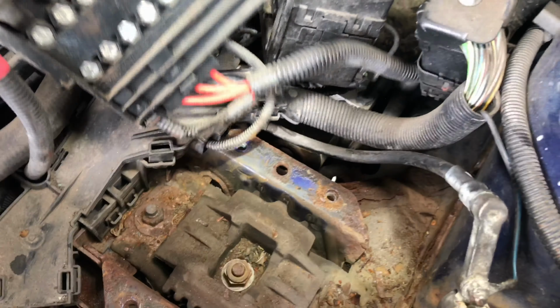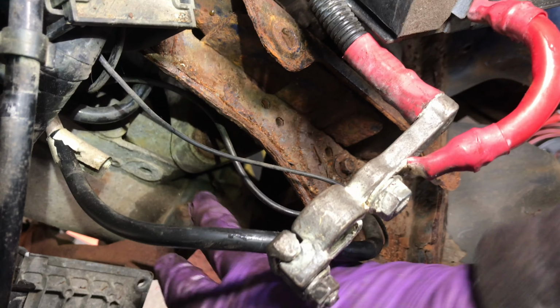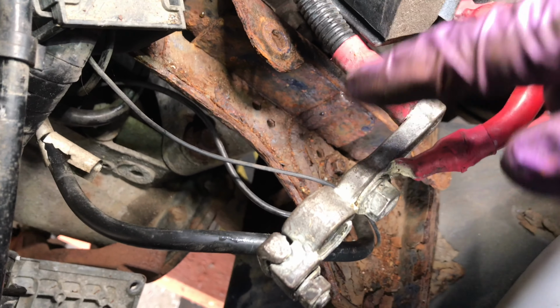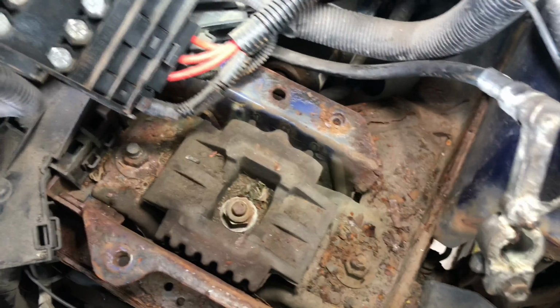Release this 18mm bolt, and that will release the gearbox mount, and it saves us from going under, see that, these 15mm. There is a way you can do it underneath there. Take that 15mm out, and there's another 15mm at the back. It saves you from doing that step. But that's more awkward when you're over a pit. That's maybe okay when you're on the ground, so I think that will remove okay, and then it's just a matter of dropping the box.